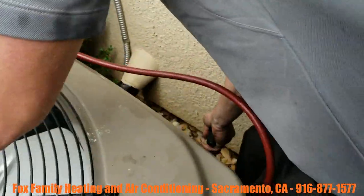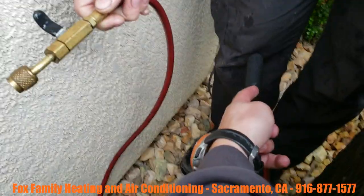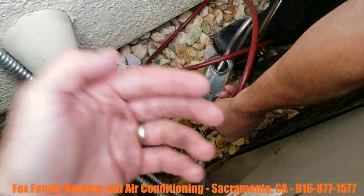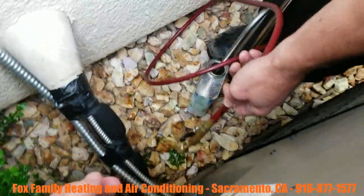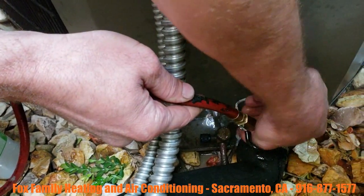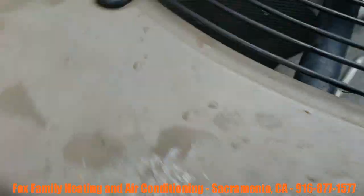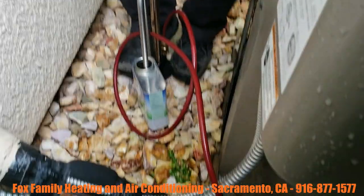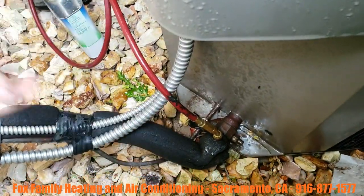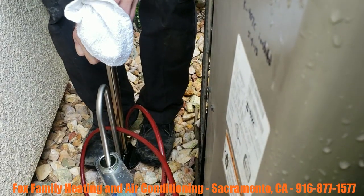Okay so we've already primed this hose up by siphoning in the oil down here — we pulled up on this, opened it, siphoned it in, and pumped it out so that we're primed. Now we're gonna shut off our valve and hook it up to the low side. For the purposes of the video I'm not going to turn on the AC right now just so we can have a little quiet, but all we've got to do is open the line up there and since we're primed we just push down and pump in.